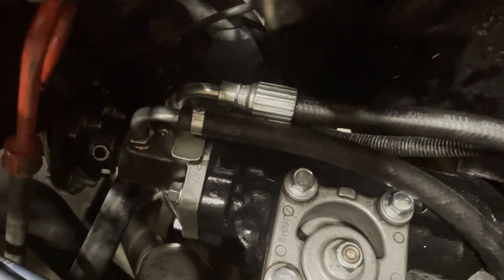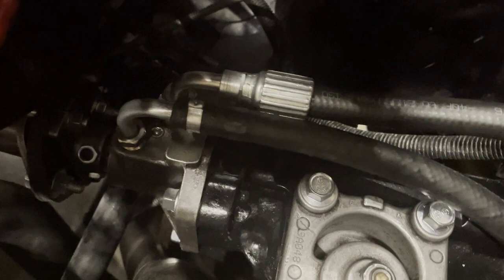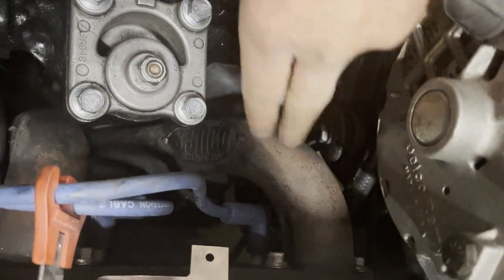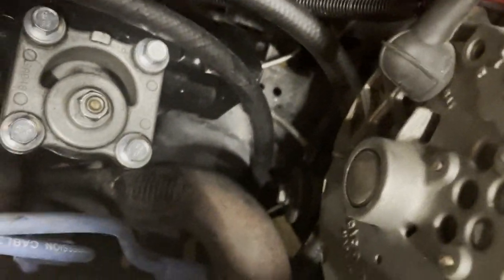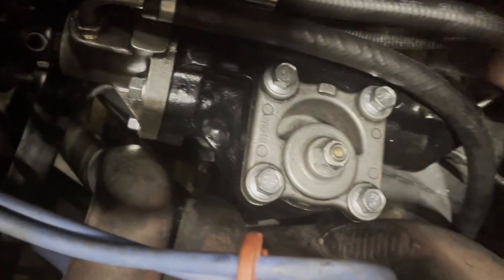All right, the hoses attach to the top of the Borgeson unit instead of going to the drag link. So routing the hoses around to make sure they don't come anywhere near the headers was challenging, because there are a couple of ways you can go. We decided to go all the way to the front of the engine and then down.